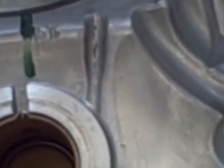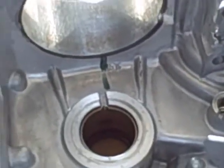Further, we've got some cracks — and these are hairline cracks. There's one right here, and then there's another one that starts right here and comes all the way down. So clearly this cylinder has been compromised. Also, where the rod lifters come in, these three areas right here for the intake and the exhaust — we have the center piece, and this is chewed up on the side. You can clearly see that. So I'm afraid the cylinder is shot.